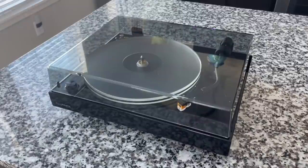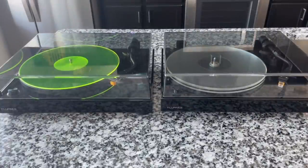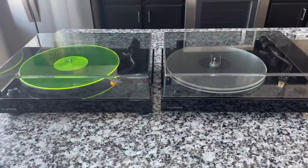And there she is, guys — that is a gorgeous turntable if I ever saw one. Absolutely beautiful. Let's look at the RT-80 next to this — bottom of the line and top of the line side by side. I'm actually surprised they're closer than I thought. The tone arm and everything looks very similar. Even the cartridge looks similar — I think that's an AT91 on the RT-80, whereas this has the MP110. The head shell looks the same, the tone arm is beefier on the RT-85, the gimbal and counter-balance look the same. By the way, there's no adjustable VTA. The dust covers and clips look essentially the same. The RT-80 is sub-$200 and this is $500 range — does it live up to the hype? Time will tell.